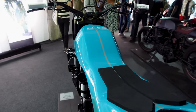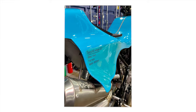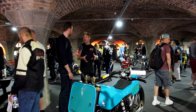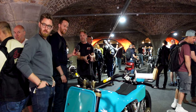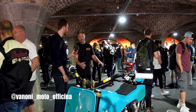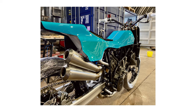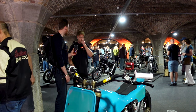How did you build the fairing? So there were two plastic parts. I started with a traditional rear flat track seat that I managed to mount onto the fuel tank, and then I bought a fiberglass tank cover that resembled a fuel tank, cut it in half, widened it, got all the angles right and got it fitted. Then I went to a guy called Max Fanoni, who fused them together and built me a mold. So I have a single piece on quick-release rubber vibration mounts, and I now have a plug and a mold so I can build as many of these as I want.